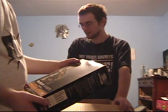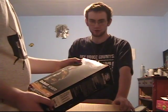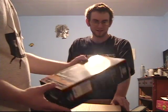This is the card I'm using to replace the 5670, the one I bought originally for my old computer, and long story short, I have this one now. This is a 1 gigabyte card, so you have a ton of texture memory. It's GDDR5, so it's actually fast and makes a difference. The 5670 was GDDR3. The difference between GDDR2 and 3 is very minimal, whereas 5 is a lot faster.